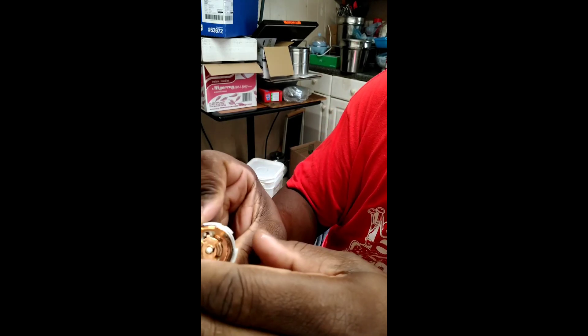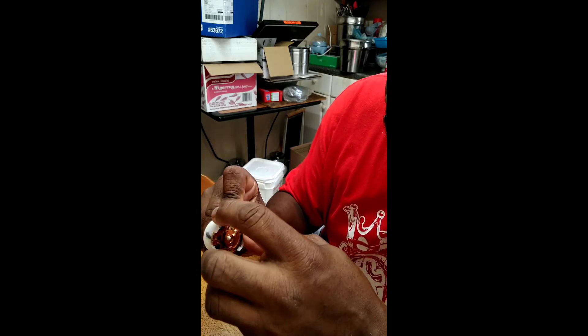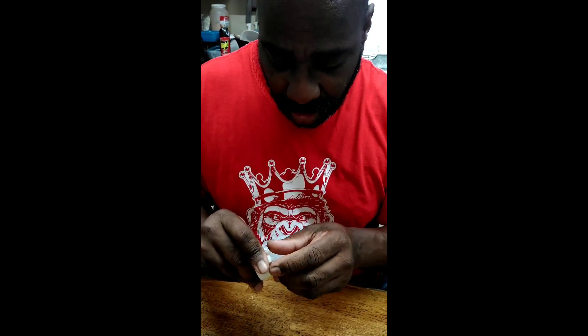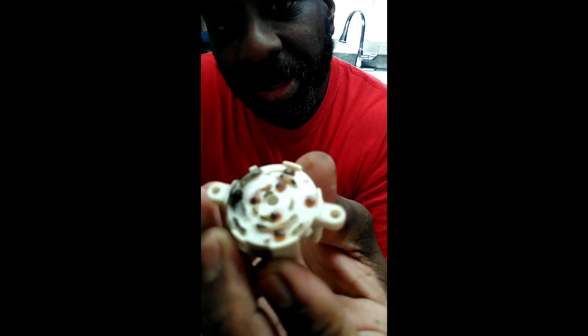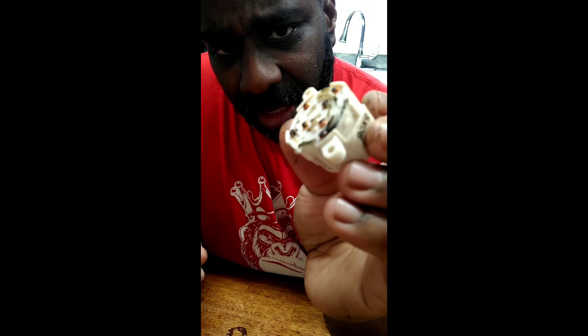That popped right back in there — I didn't clean it, but you can clean these if you can't find what you need. Make sure you hold on to these little springs and stuff on the inside. This one comes out — a little copper ring — you can clean that off and raise it up a little bit. These have worn down, and I would suggest you take these springs and pull them out a little bit so they get a little bit taller and touch the surface they need to touch. Clean these little pins off too because they are dirty and black. Take a Q-tip and a little bit of alcohol and clean all that stuff off.